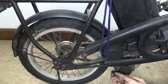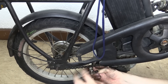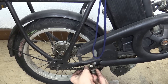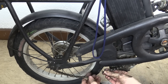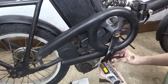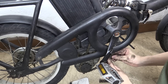We've still got the pin here, and we managed to split our first chain. Now let's split the next one — and we should hopefully be able to take this apart now. So we got it apart, and we've still got the pin in, which makes it easier to push through when we reconnect. Now we can see the chain is on here fine, and we need to work out where we're going to break it — we want it fairly tight. Maybe that one is going to be the best we can do; it might be too much slack, but we'll try it.